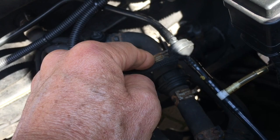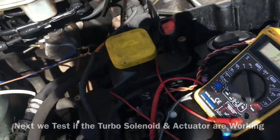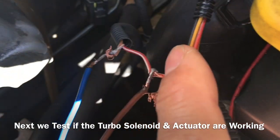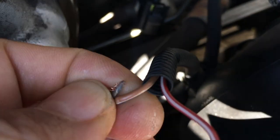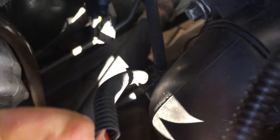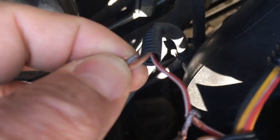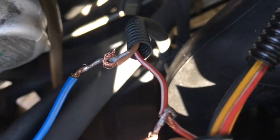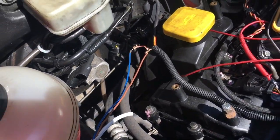I did the same on the vacuum line going off to the boost control solenoid — that seemed to be fine. You can also manually engage the solenoid by tapping into the wire. There's a T-junction here — remove the plastic cover and the control line is the brown and white wire. The red and white wire is plus 12 volts. When the control wire is taken down to ground, the solenoid fully activates and you get maximum boost.